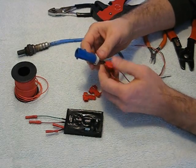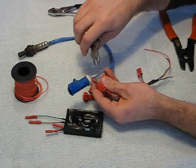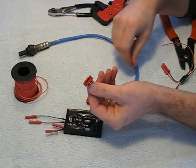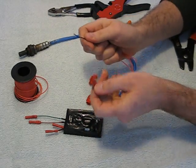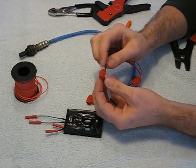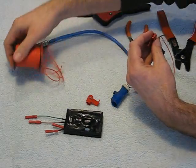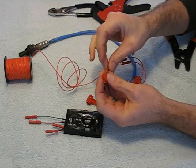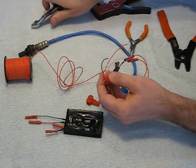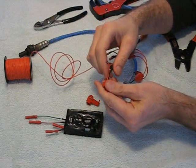Once you've located that, you want to take some nippers and cut the wire — this black wire here. You'll take one of these easy connectors, and with the wire coming from the O2 sensor, stick it into the crimp connector until it doesn't go anymore. Then take your hookup wire, slip it into the other hole, take a pair of pliers, and crimp the connector closed. That's it — the connection has been made. Close the cover — that covers the terminal and you're done.